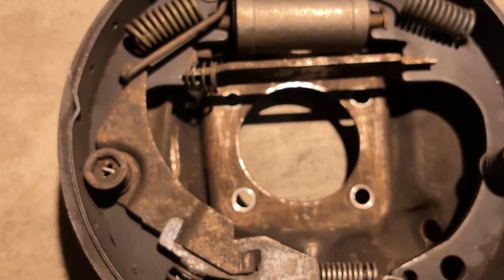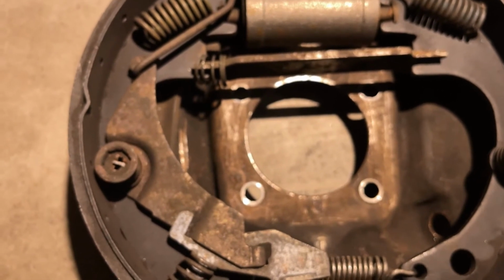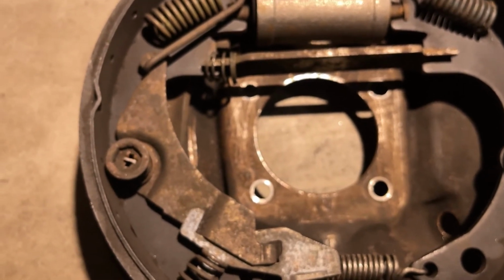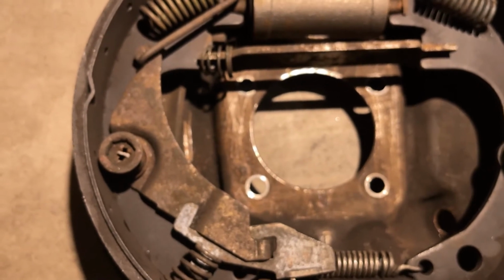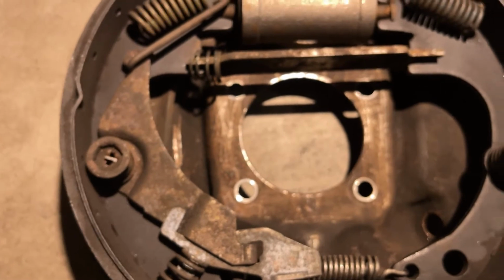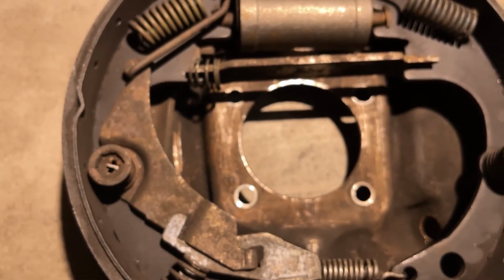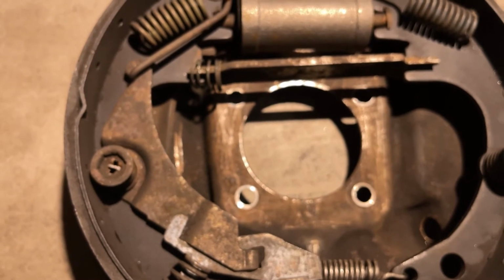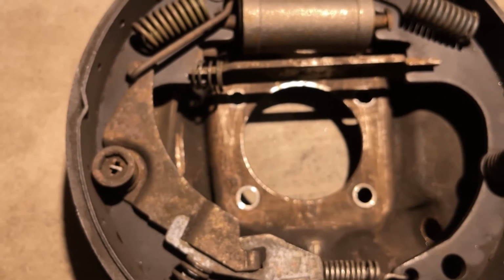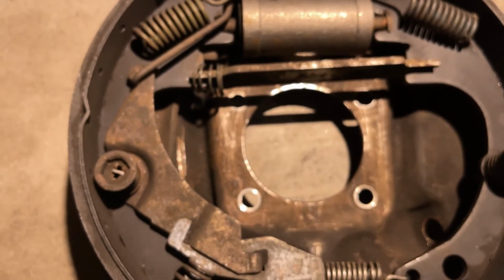And in Moser's directions, they basically tell you that you need to give it a light tap with a hammer. They don't exactly say where to tap or how much to tap or how far to tap. In this case, since this car is primarily going to be a track car, drag race only, there's no need for an emergency brake. So I've gone ahead and pulled out the emergency brake pedal and cable all the way back, hence the spreader bar won't be needed anymore.